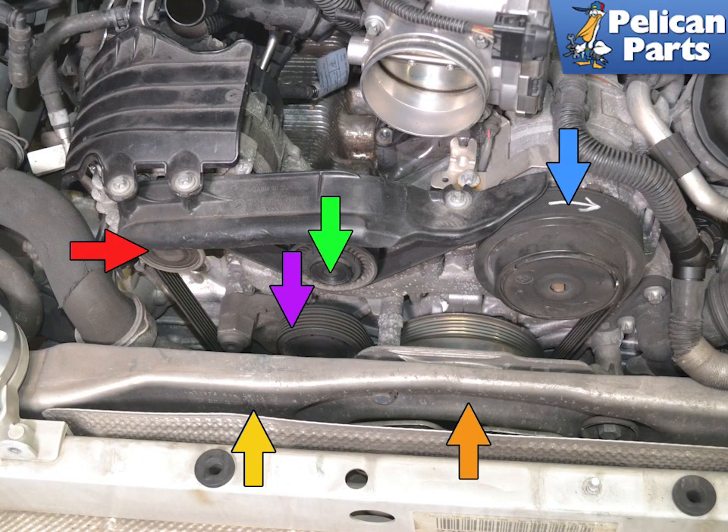There is very little room between the belt and the carrier and accessories — you will need to work both above and below the engine. When installing the new belt, begin by turning the belt sideways and slipping it between the carrier and the vibration dampener. If at any point damage happens to the belt while installing it, stop and replace it with a new belt. Position the belt on the running track on the vibration dampener, indicated by the orange arrow.